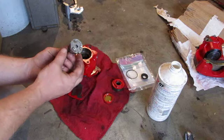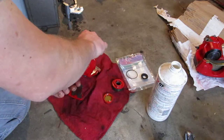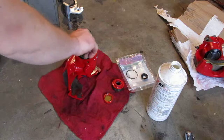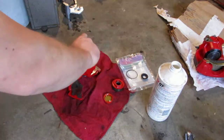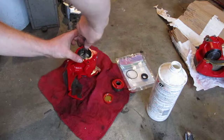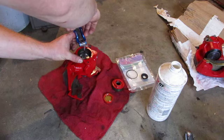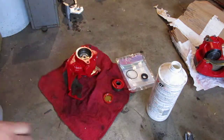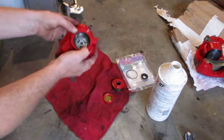Everything above here will be lubricated with grease. We'll go ahead and drop that piston down into the caliper and it threads in. It's got a hex key in there so you can go ahead and use it. You want to be certain to line up this area where the alignment pin is going to go.